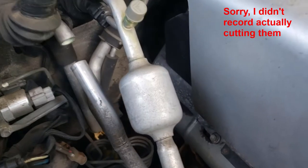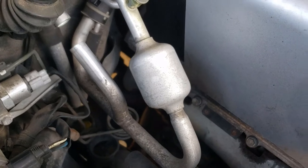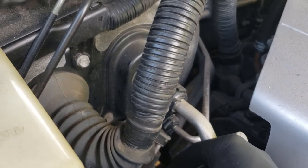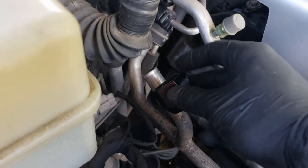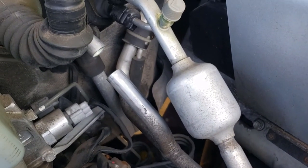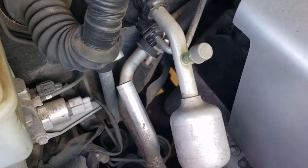I just got those cut. Here's the first one on the low pressure side. I took out a little bit bigger chunk just to give some clearance for getting that end cap in there, but I also wanted this piece to sit down far enough. Right about there — so I wanted to give it a little bit of clearance on this straight piece of tubing to work with. But then I took off a little bit more up above it just so I could work on getting the cap on without twisting the tubing too much.